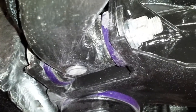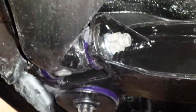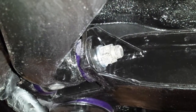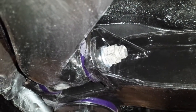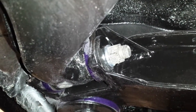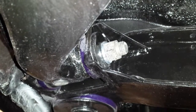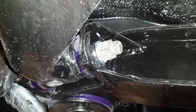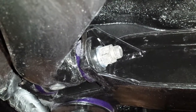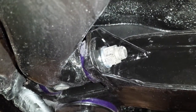And it actually changes the roll center too, which is a side benefit, because the angle that these arms are at, I personally believe they get too much camber gain mid-corner. When we hit the bump stop after about 2-inch travel from our target ride height, we get about 2.1 degrees negative camber, which is not bad at all.